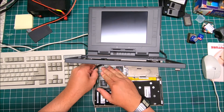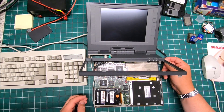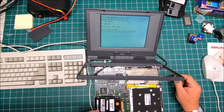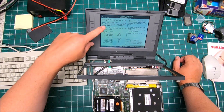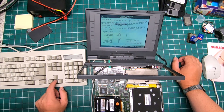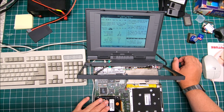Let me power it off, let me check the cable — the cable was good. Why did it die all of a sudden? Let me reboot it. Let's go first into the BIOS and see what we've got. Date is screwed up. 3.5 floppy, 1.44 megabyte — it looks like detected. External disk drive: not installed. Hard drive zero: none. That's no good — basically it didn't detect the original drive, which I kind of assumed.